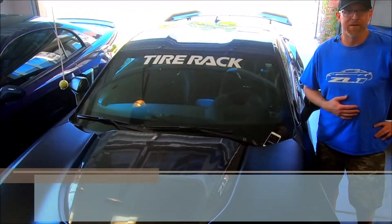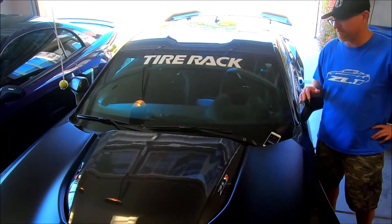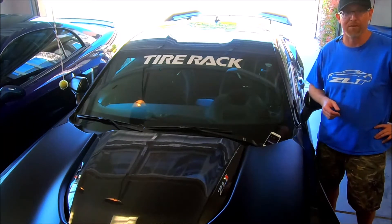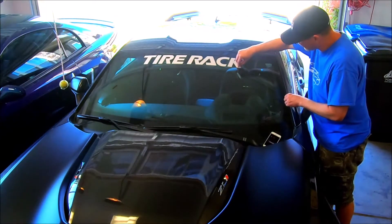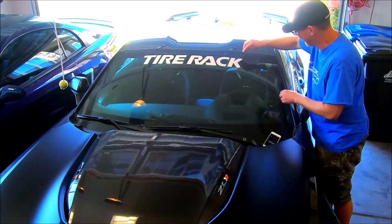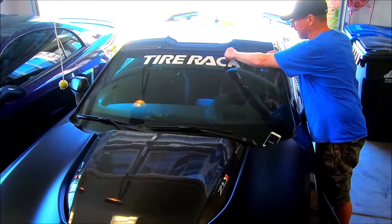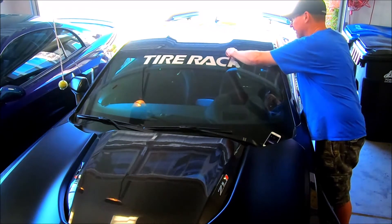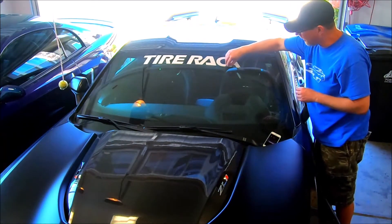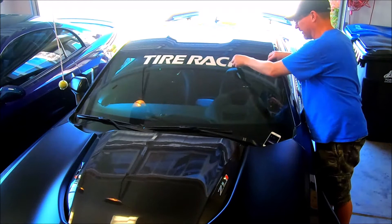We kind of ran out of shade in our driveway and we don't want to wash the car in direct sunlight, so we're going to do some additional detail work — I'm going to get the stickers off. These stickers have been on for a very, very long time, maybe since 2019. We're going to get the vinyl off and then use WD-40 or isopropyl alcohol at 50-50 to remove the adhesive. The adhesive is stuck on here good, so we may even have to use a razor blade.